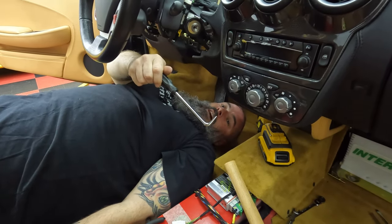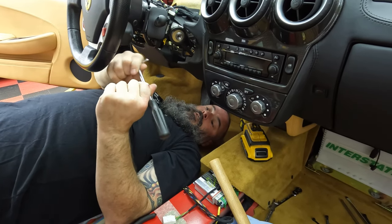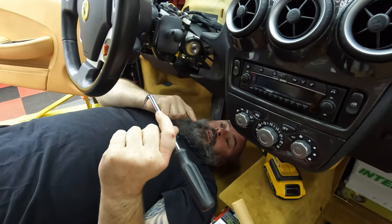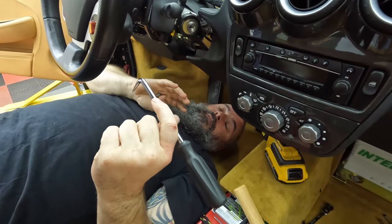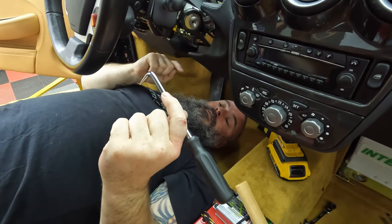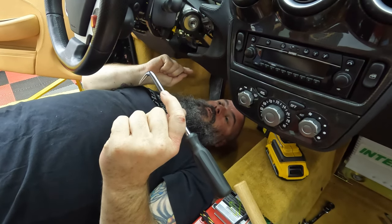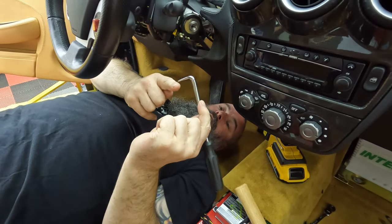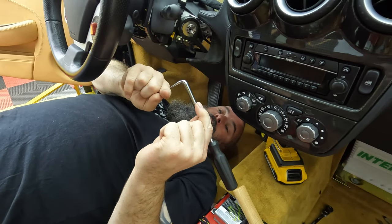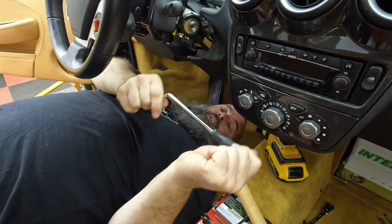90 degree was better, actually. So you put it in the hole. You've got to be real careful when you drive the pivot pin. You need to really make sure that hole is close. Really close. And then once you get it where you think it is, then you hook through the clearance hole that the bolt goes through. Once you're in there, then you can cock it. Just walk it.